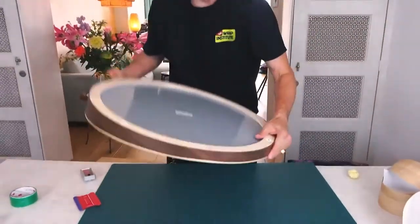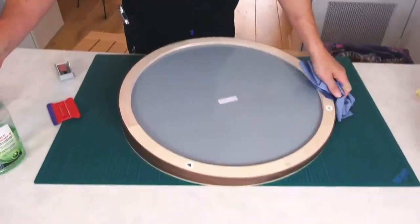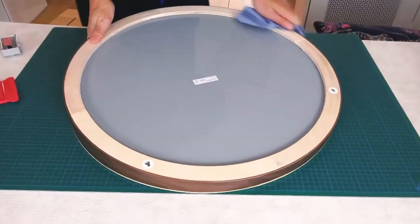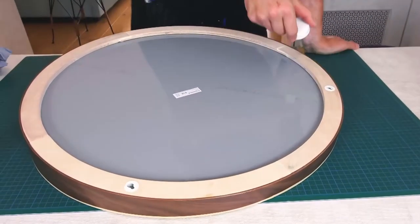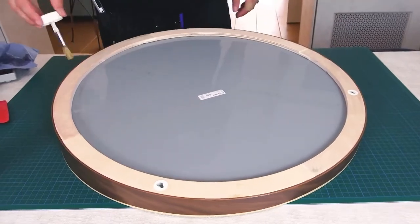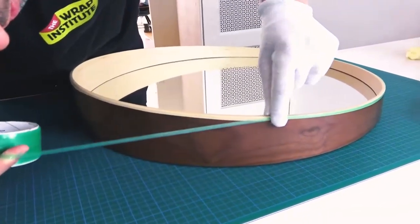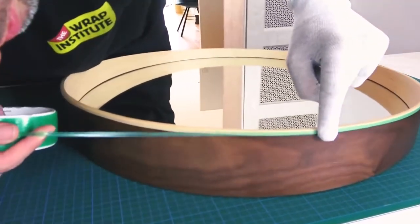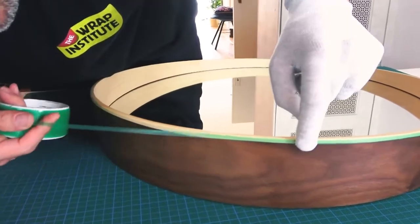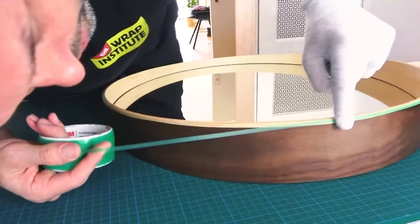Flip the mirror carefully over and set it on the cutting mat face down. Spray SOT Surface Cleaner 2 on the paper towel and clean the back edge. Then add an even layer of CoverStyle primer to the edge and allow it to dry roughly 10 minutes before install. During the drying time, the knifeless tape can be placed on the edge of the piece that was just cut off, so there will be an overlap of roughly 2–3 mm. This will help ensure long-term hold. Make sure the knifeless tape is applied 100% uniform from side to side.